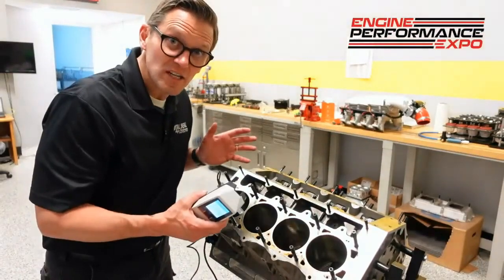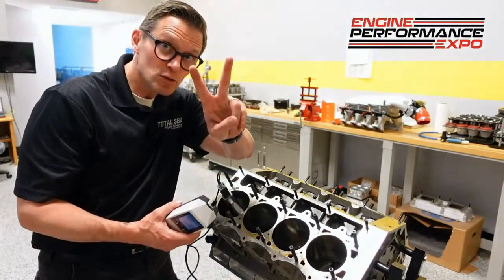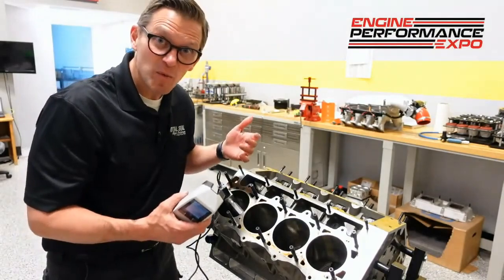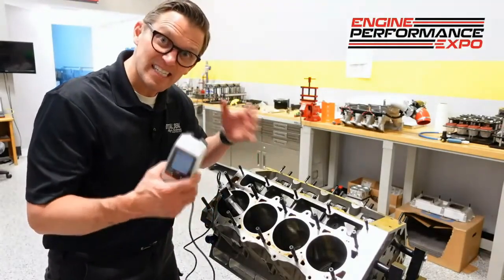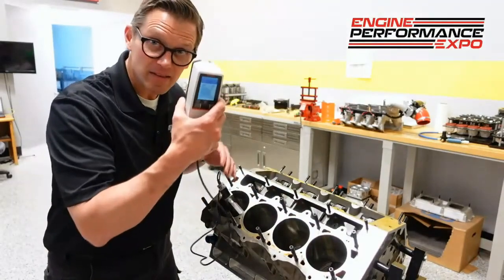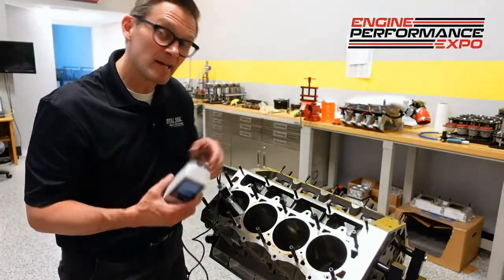The whole change is just the fact that there was some corrosion from the engine sitting literally two months. Wish we had some of Gary and Steve's Fogit when we had the engine on the dyno so we could have fogged it down. Definitely next time we're going to do that. But we figured you might want to see: when you can see some corrosion like that, the profilometer can definitely see it too. It's definitely changing the surface finish — something to keep in mind.